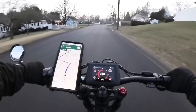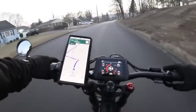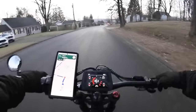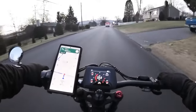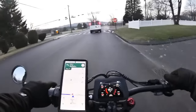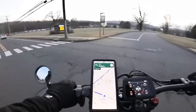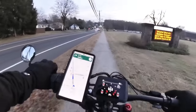If you're turning or in a situation without a lot of traction — like sand or leaves — definitely don't use the front motor while turning, because you might fall. That front wheel can lose traction easily. Although this does start you off easy — it's still a 48-volt system with 22 amps being sent to the front. Jumping this curb is so easy with the big wheels and the shocks.